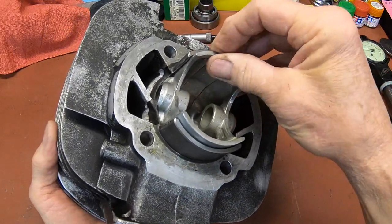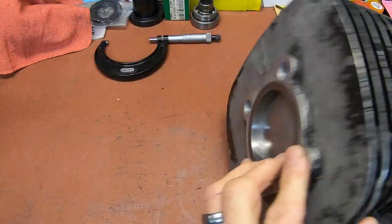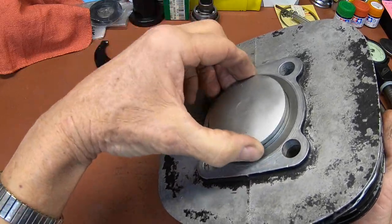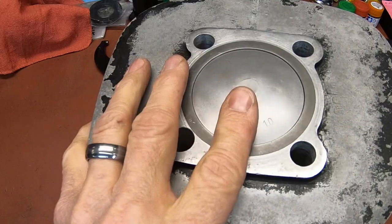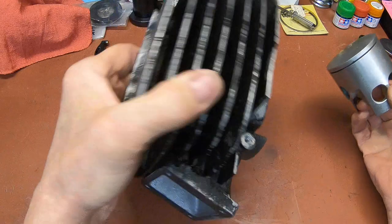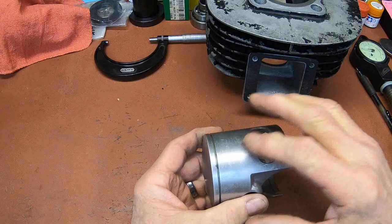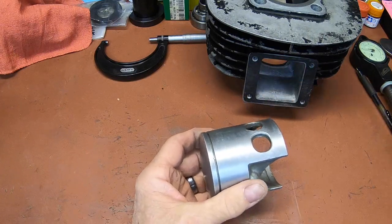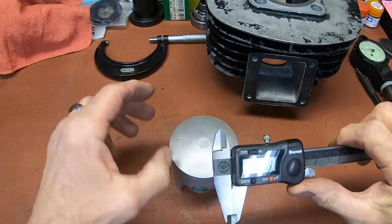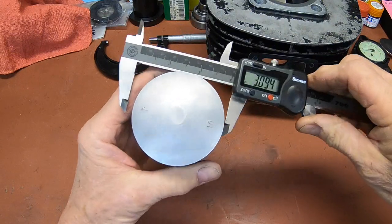And here's our fit. And we did go to 1. You're gonna have more at the top because your piston is gonna swell. Your piston is not straight up and down. It's probably about 10 thousandths or something like that. I know I've measured these before, or other pistons, and that's about what they turn out to be. So if you measure it right here at the top,